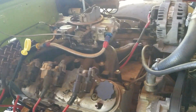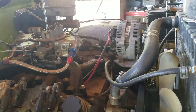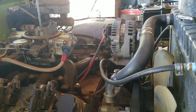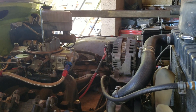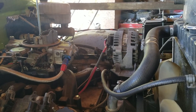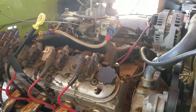You can't really see any wires except for that connector for the coil. For the alternator, you're going to need to wire it separately — there's no MSD provision for that included with the kit. You can buy a Holley connector or another type of connector that comes with a resistor and pigtail. You'll have a 10-gauge wire that goes from the alternator to your junction box, and then a sensing wire that also goes to 12 volts but needs a resistor in line so you don't overcharge your battery or overheat the alternator connector.